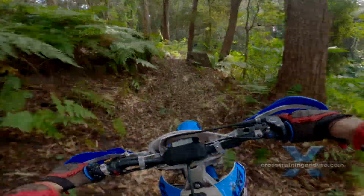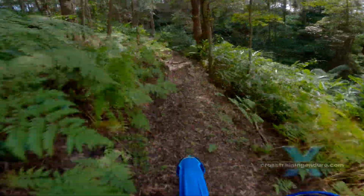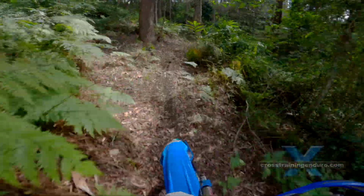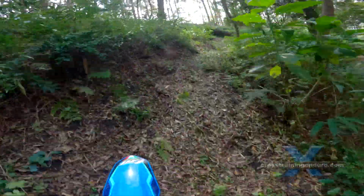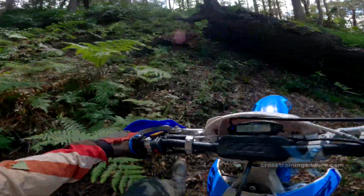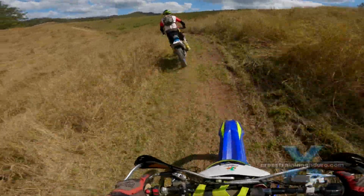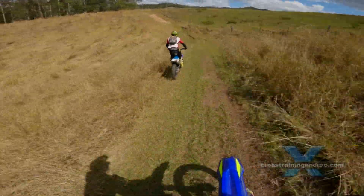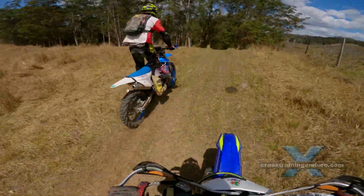We trawled the forums looking for any major known issues, and we couldn't really find anything that stood out. There were definitely TPI issues, but the carb models appear to be very reliable. A few owners said the battery can flatten easily if you use the starter a lot. Others reported very heavy fuel use and some plug fouling until they got the jetting right.